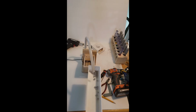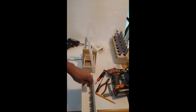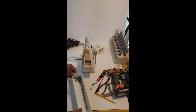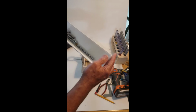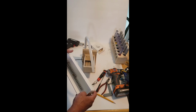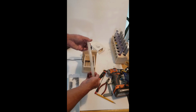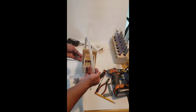However, wait till this stops. However, if I fill this thing up solidly with balls, it probably will jam. And that's because balls like to nest, you know. It's just in their geometry, and they almost turn into a solid in there, and the agitation can't occur because it's almost like you got a piece of metal pushing against the whole device, and that's not good. You want this thing to be able to breathe, so you let it keep up with the flow of balls, and it'll work flawlessly.